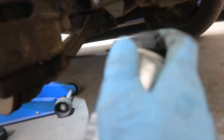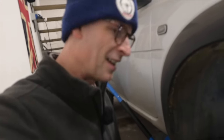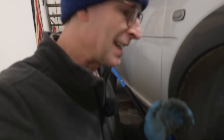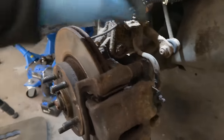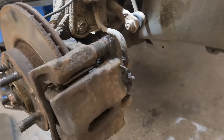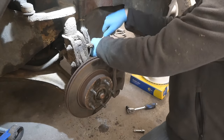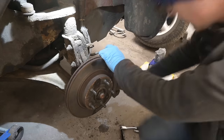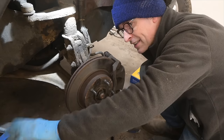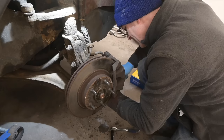Hopefully I'm only going to have to undo a couple of pins. I have the slight advantage today that I'm not going to worry about bleeding this because the rear calipers and drums still need sorting out, so I can just whack it all together without bleeding — which is quite handy. Right, I'm just gonna start with a nice easy one — taking the pads out — which should mean just undoing these two 12mm bolts here. The flexi is very much in the way though so I'm not quite sure how we'll work around that. It was all soaked in Bulldog so hopefully it'll come undone easily. Okay, so not a 12mm — it's just loads of crust on it.